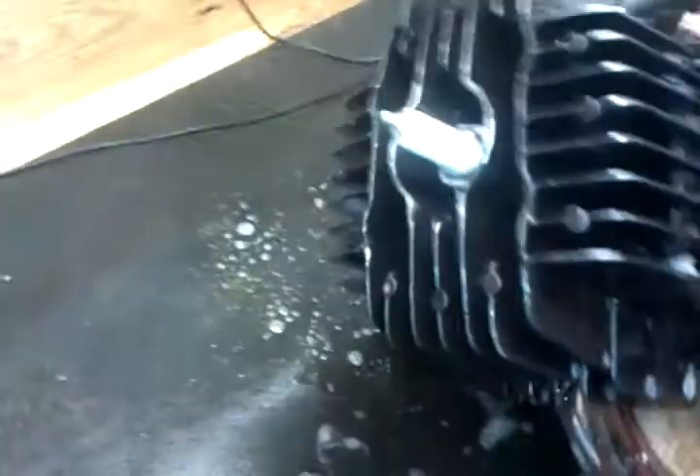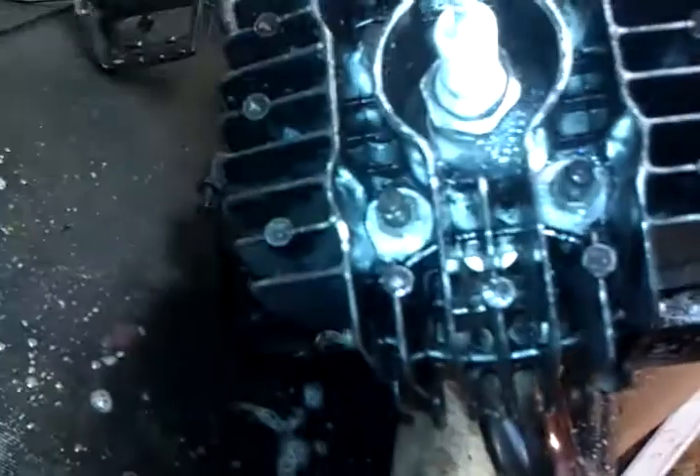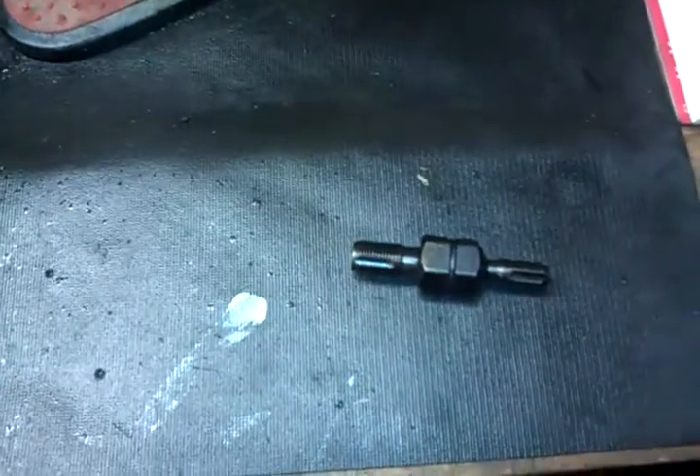So how do I see where the leak is? I've got this little bottle of soapy water and I'm just going to spray around the case, base of the engine, head, intake, and stuff. If I've got a leak, we're going to see it bubbling. Nothing here, nothing there, nothing really there — but I can hear something up here, and you can see it's right around the spark plug. I've done this before, so I already knew it was leaking there. It's torqued down pretty good, so what I'm going to try is chasing the threads with this spark plug thread chaser — maybe my threads are a little messed up and this will help me get a better seal.